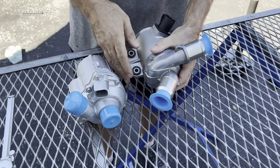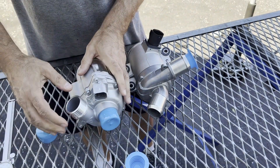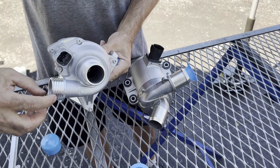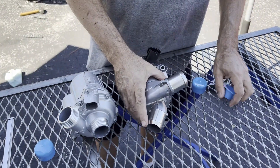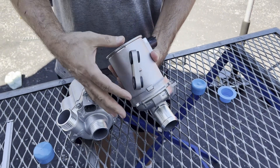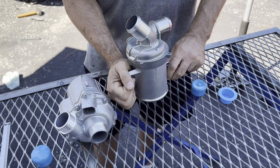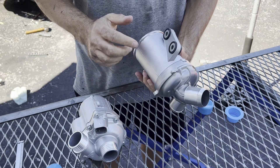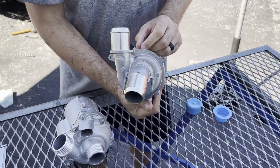The Fusion pump is a little bit different — you can see how the inlets and outlets stick out. There's also a difference in the connections: the BMW has a corrugated end to clamp on, while the Fusion has smoother ones. The Fusion also has angled mounting points, so you'd have to get creative with a bracket or mount it at a strange angle. Having the big body in the center means you'd need a split bracket of sorts, but it's not the end of the world.